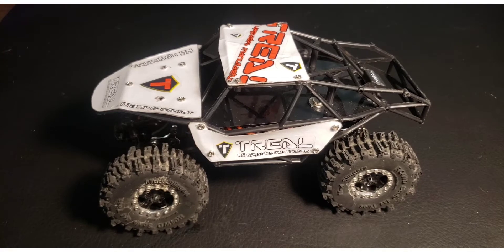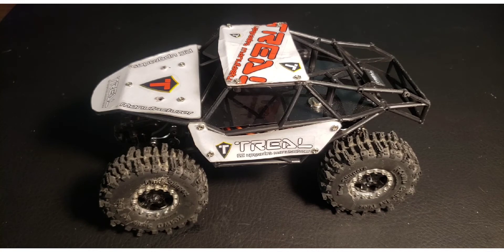As I've been driving it, it does not perform as well as a modified SCX24. It will outcrawl a stock one easily, no problem. The reason it won't outcrawl a modified one is that if you modify the back of an SCX24 to have hyper extension and hyper articulation but leave the front stock, it can do some incredible things. On steep climbs you can draw the front of the truck up and leave the back tire on the ground, so you don't have to lift it immediately — the suspension flexes out, the wheel drops, and once the front tires are up they grab and pull it up.